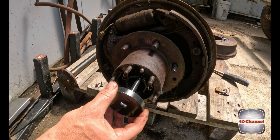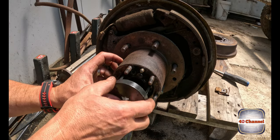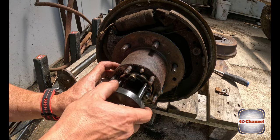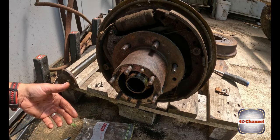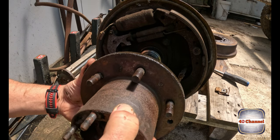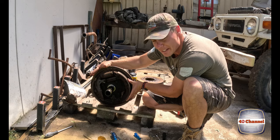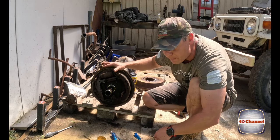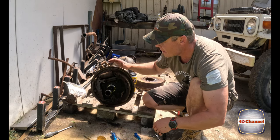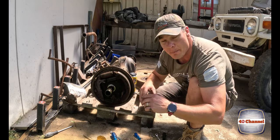Normally you'd use this special tool to undo it if it was tight, and you certainly use it when putting it all back together. We're going to try to pull all this apart without losing any of the bearings - try to keep it all captured. This whole backing plate can come off now with all the components - only four bolts. Pull the whole lot off, take it inside, put it on the bench. We can rebuild it all, change out for new cylinders, new pads, new internals, then when we come to the troopie it's a straight swap over.